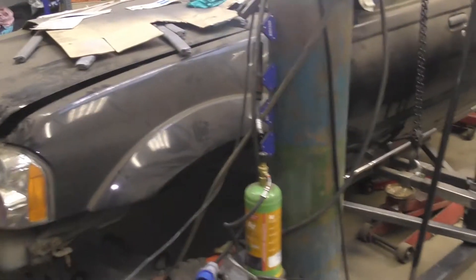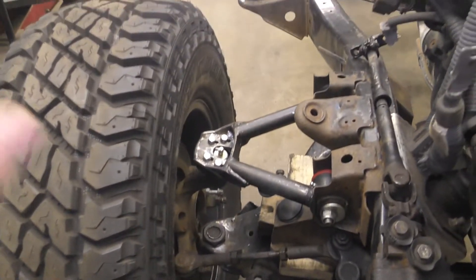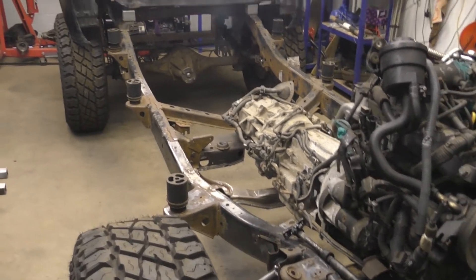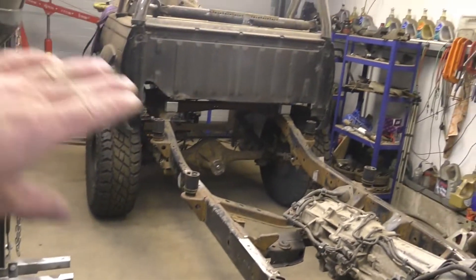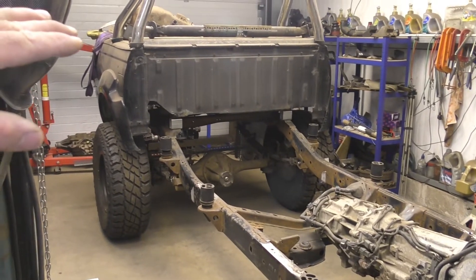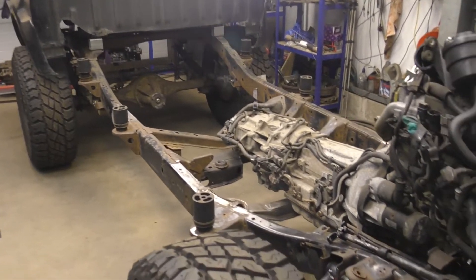Once that's done I can get on the front — the steering and suspension are pretty much sorted. The reason for dropping the body now is to sort out the right height, just to see how the truck sits. I want a little rake — not a perfect horizontal, but probably half a degree rake to the front of the Jeep, so with light loads it levels itself out.